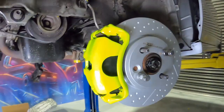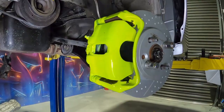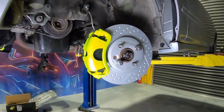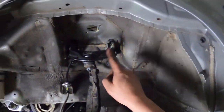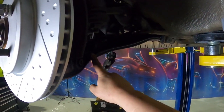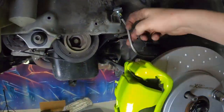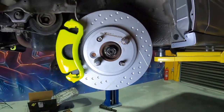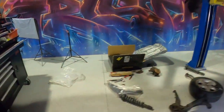We've also gone with some ceramic brake pads, which are a lot higher heat tolerant. And we've got the Integra / Odyssey / Prelude / Accord front brake upgrade on there now. So brand new upper arm, brand new lower arm with the provision just here for a sway bar. And we have Saferide braided brake lines. So they're awesome. So we've got the full brake upgrade now. Just a matter of fitting the brand new Max Speeding Rods coilovers.